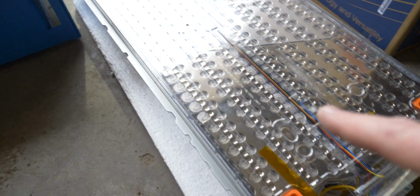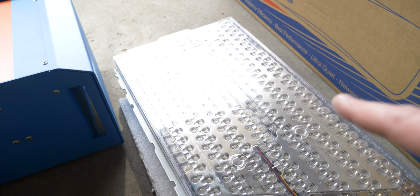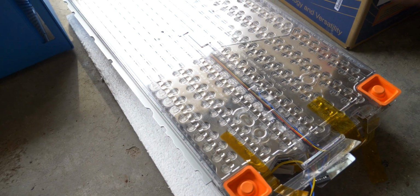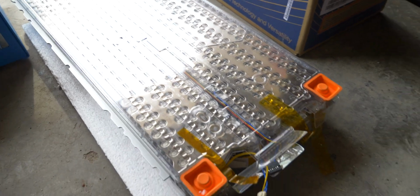The first thing you have to know is this is going to be designed to be an off-grid rig. Boondocking all the way. So on the roof, I will be putting 4 of these 335 watt SunPower solar panels for 1,300 watts of solar. To store all that power, I will be installing 2 Tesla Model S battery packs for a total of 500 amp hours at 24 volts.